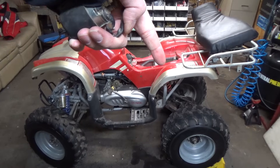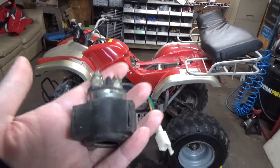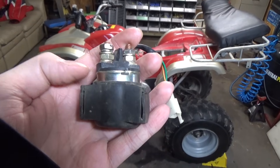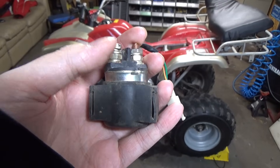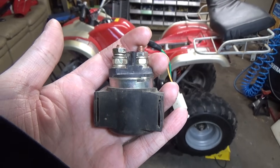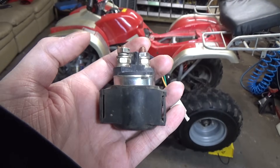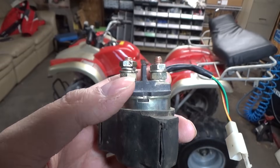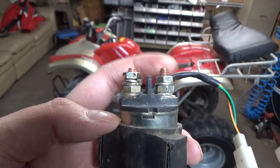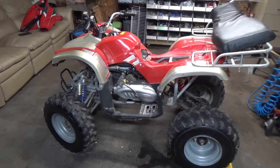12 volts is sent from the battery up to this right here, going through this line into here. There's a little magnet in here with a steel bar, and it has a spring on it so that it can always return to its normal position. When you push your push button start, 12 volts goes to this solenoid and using an electronically charged magnet, it pulls up that plate. Once that plate lifts up, it connects 12 volts to your starter. Now whether or not you have spark, that's a different circuit altogether.